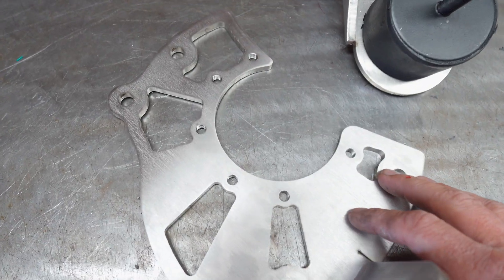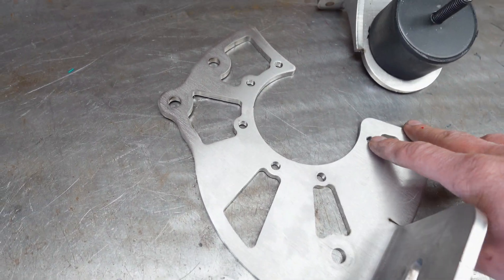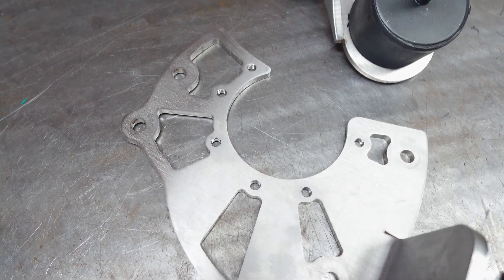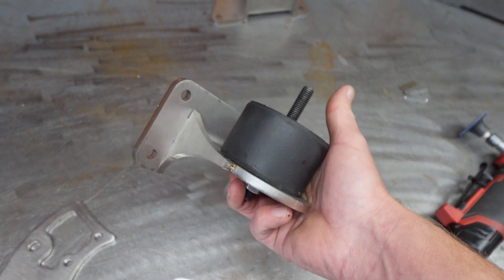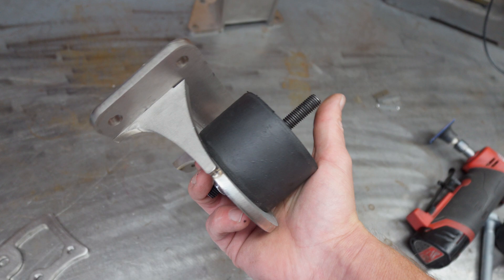The alternative was a much more reasonable laser cut and bent part. The motor side of the rear motor mount bolts to the transmission where the all-wheel drive transfer case used to sit in the RS3, and I included a smaller secondary bolt pattern to contain the seal housing and keep fluid inside the transmission. The rubber mounts are a factory BMW E30 part — I typically prefer rubber mounts as polyurethane and aluminum suck on a street car, creating a much more enjoyable driving experience and limiting noise and vibration.